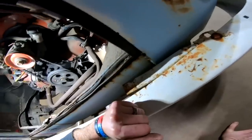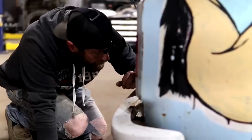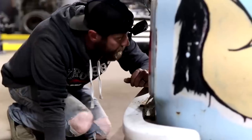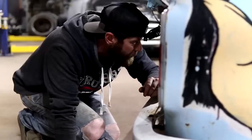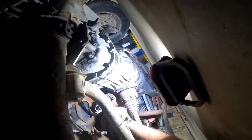Right. Yeah, I see a wire that's got tape on it. Yeah, there's one that's got tape on it. That's going to be what runs back to the ignition switch. Right there? Yeah, that's what's going to kick the solenoid in and out. It runs to a separate terminal there, right? Yeah, it runs to its own. You want to mess with that splice? Is it spliced? It's kind of like a butt splice thing. It's got a male and a female clipped together.